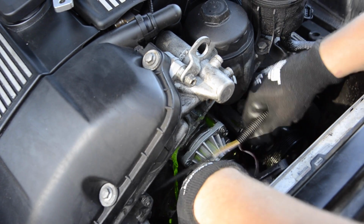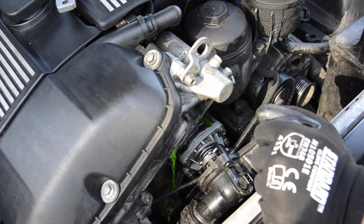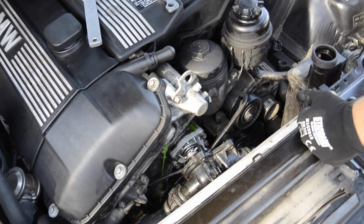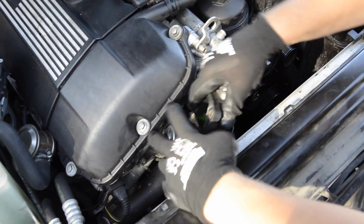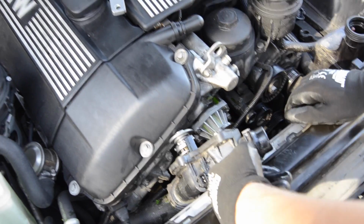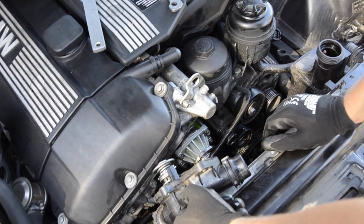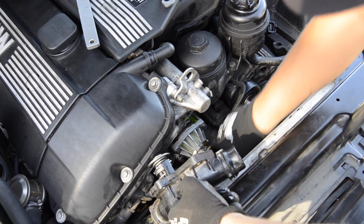Last time we refilled it with nice coolant, but as I can say by my experience, someone has been using silicone on the bolts, which means they're not really professional about this stuff. Alright, next step, we'll disconnect the thermostat. I'll just put it aside for now because I want to replace the bottom hose with minimum loss of coolant, because last time we were here I filled it up with completely fresh mixture of coolant concentrate and distilled water, and it's still good. So we'll take the water pump out.